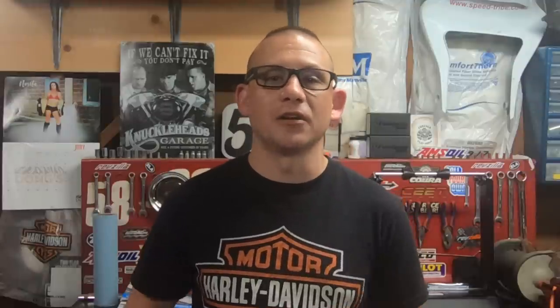Everything comes down to your pinion runout. '99 to '02 had better pinion runout. Now, while 2003 to 2005 models got more miles out of those spring tensioners, those crankshafts had more runout, and with that consistent pressure being applied from the spring tensioner onto the cam chains, while you were getting more miles, it's still a threat to the engine.